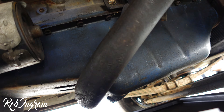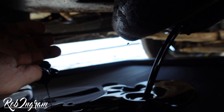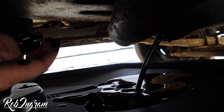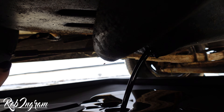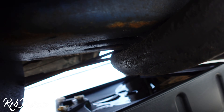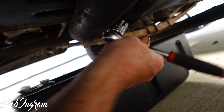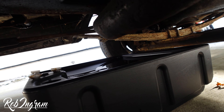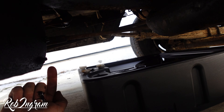That is the oil plug, and it's at the lowest point on the oil pan. You slip the pan underneath and when the oil starts draining out it falls down and gets collected. Let's go ahead and yank that bolt out. Once you have it loose, you'll see it starting to drip, then it really flows. Man, that oil looks pretty nasty — look at how black that is. We're going to let this drain for a few minutes. Once it's drained, replace the plug with your socket set and tighten it back down. Don't over-tighten it or it will leak.